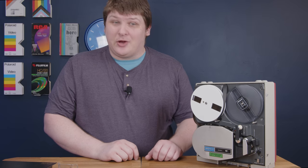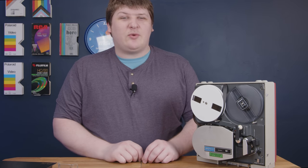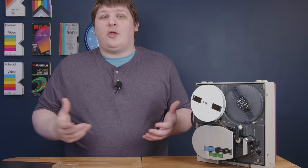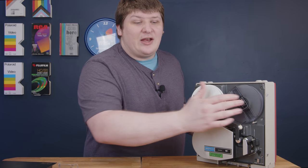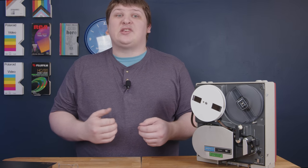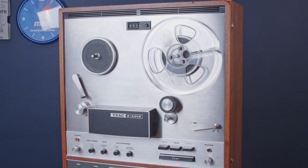Here it is in all its complicated glory. There's a lot of parts, especially under this cover, and I'm going to try and explain what pretty much all of them do. This machine records analog video on magnetic tape, just like a VCR, but different. The biggest difference is that instead of using cassettes, it's an open reel mechanism. If you're familiar with quarter-inch audio tape, you might be familiar with the open reel concept — instead of having a cassette that contains a pair of reels, you have distinct reels and you load the tape by hand.